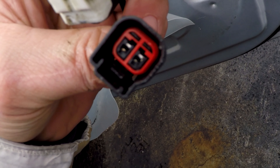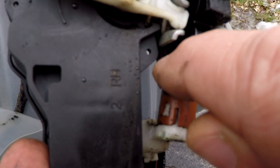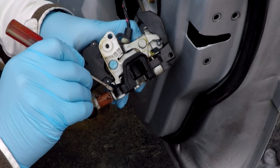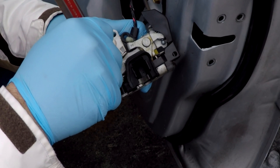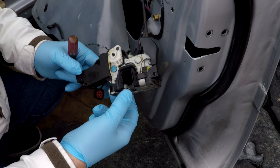Look at all that moisture sitting in there — that's crazy. There's a little clip in here that we have to pop out of the way and this should twist right out. There's the door ajar switch — looks like crap. New switch, slide it up in there. To take it out it's counterclockwise; to put it in it's clockwise. Turn it clockwise and it locks in.